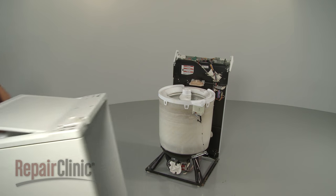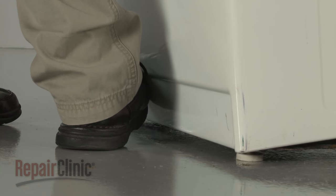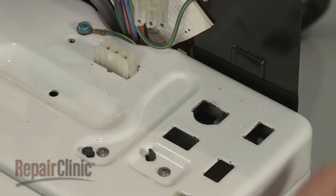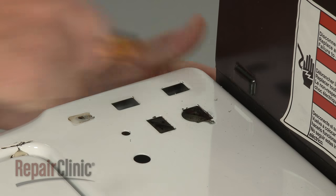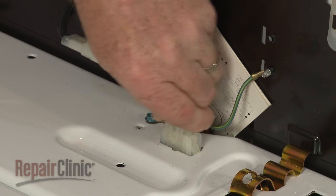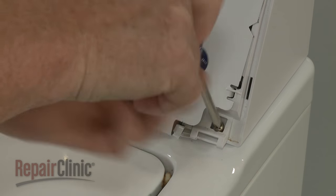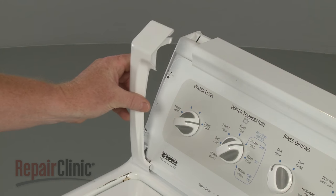Re-install the cabinet by sliding the front edge of the cabinet underneath the base frame. Use your foot to push it into position. Align the two notches in each side of the cabinet with the tabs on each side of the base frame. Make sure the sides of the cabinet are properly aligned with the rear panel. Re-install the spring clips to secure the cabinet. Re-connect the lid switch wire connector. Lower the control panel and snap the retaining clips into the slots in the main top. Re-thread and tighten the screws to secure the control panel. Re-align the end caps and snap them into place.